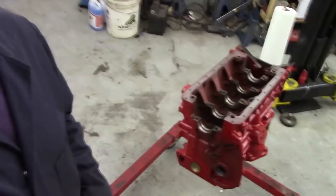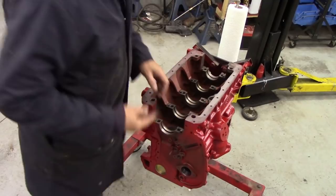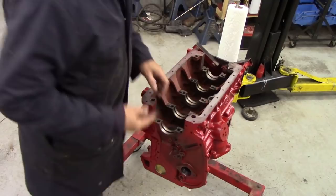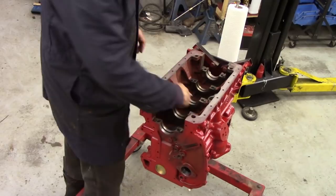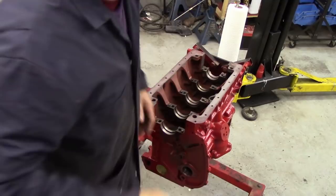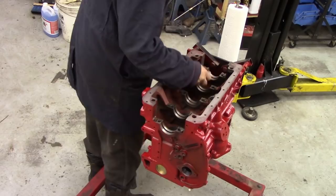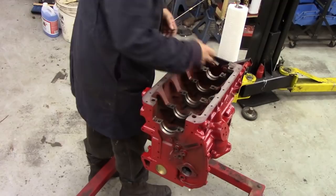Look how easy it is to move that around — isn't it a joy! First of all, on this engine because it's an old one, I've just got some very fine emery cloth here and I'm just going to run it around the shells — where the shells would fit — using it to take off any high spots, grease, or anything like this. You can also feel any burrs; if there's any burrs on that block you can feel them. They're looking quite good. Because this has been stood for such a long time things get a little bit rusty, as you can probably see on the paper. We'll take that surface off and just make sure those shells are going to go down and sit down properly, and also remove any overspray of paint.